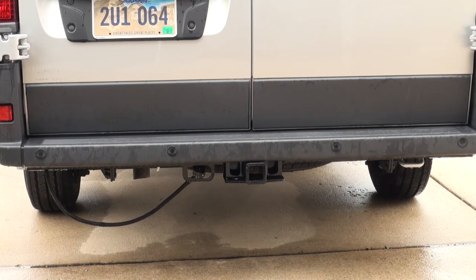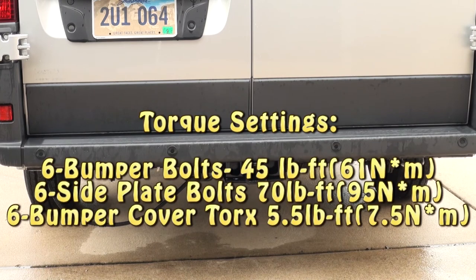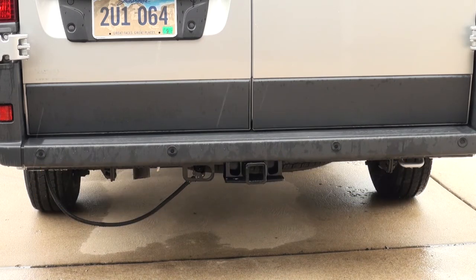I went ahead and got the cover on. What's interesting — at least with this Mopar — the underside of the bumper cover, about nine inches wide and about an inch and a half, you have to trim out the plastic. The metal reinforcement just kind of blocks it; it's in the instructions. For the last step, I've got the four Torx bolts up at the top holding the cover on. What's peculiar though: the bottom four Torx — only the bottom two corners had threaded holes, so there are two Torx bolts in the center just adjacent to the receiver where you won't have a Torx that tightens in there. And the last thing I'll do is put the 7-pin connector in.